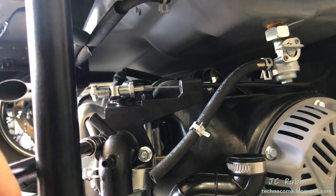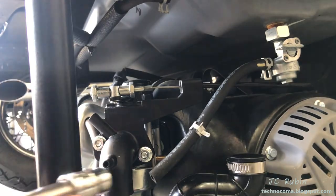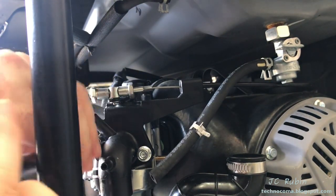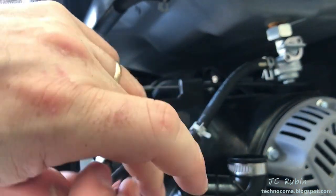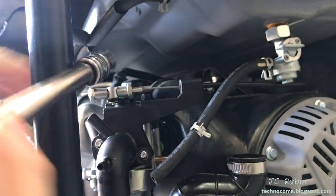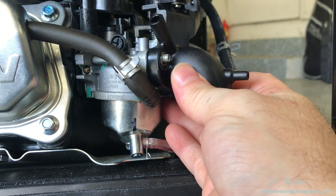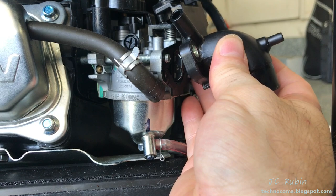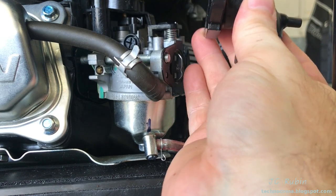We're not going to concern ourselves with any settings on the choke or the electronic throttle control unit — only the two nuts that hold the manifold on and through that stud, the entire carburetor. This is a 10mm socket; I find most of these carbs are a standard 10mm. I'll loosen these nuts off the stud on both sides. Be sure to keep track of all parts you're removing. Now I'm able to slide the manifold right off the studs.